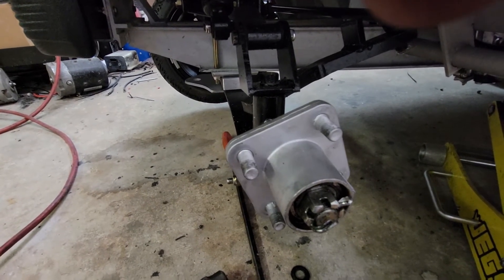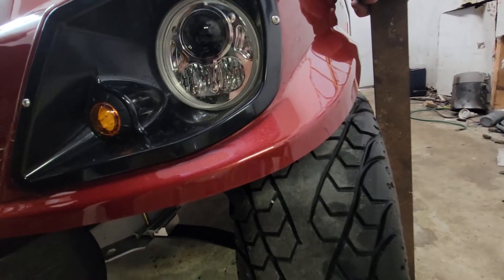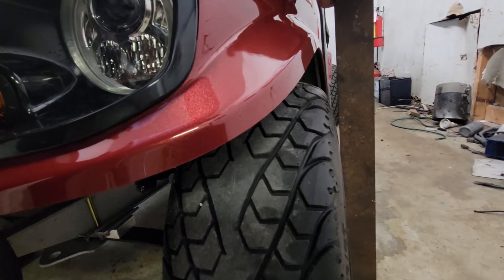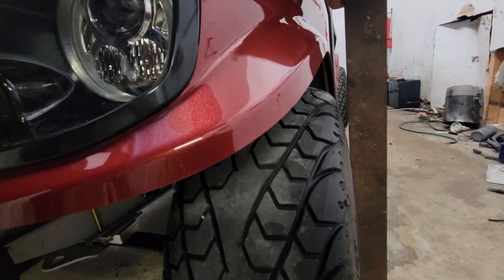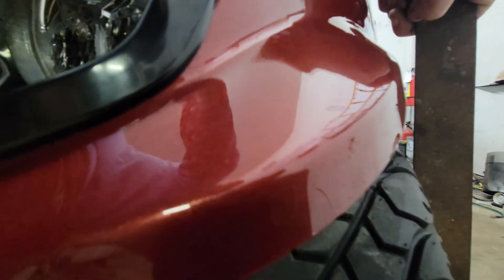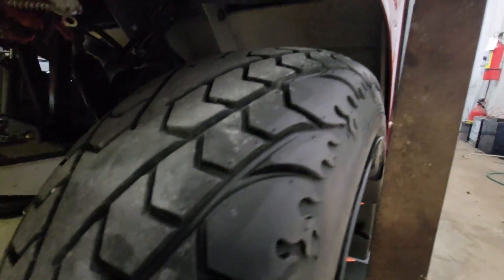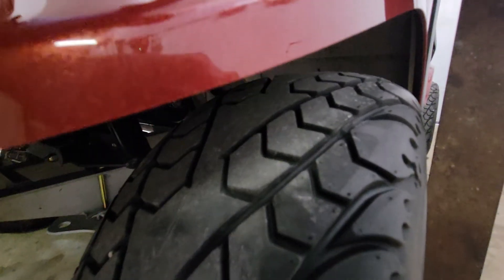As you know, on a DS there's no adjustment for camber. We went from roughly almost an inch gap from the square to the top of the tire hitting at the bottom, down to about a quarter inch — maybe five-sixteenths. That's way closer to stock suspension camber. Let's check the other side.